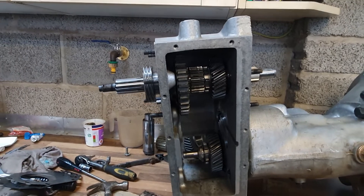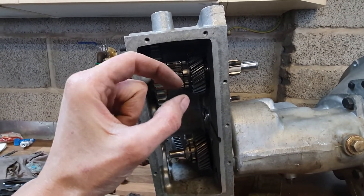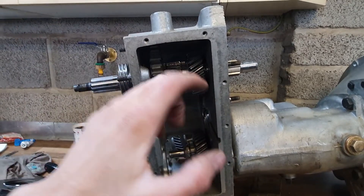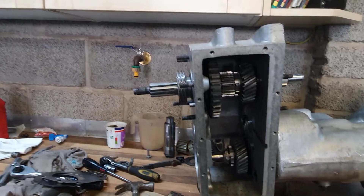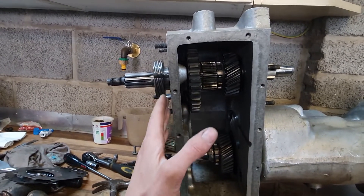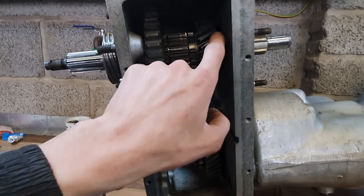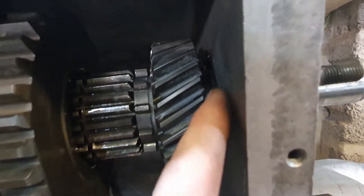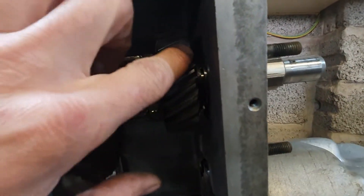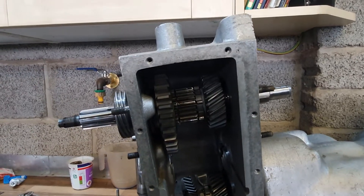I think I've found out now what's going on. The circlip has two tabs that you grip with the tool and those two tabs obviously stick out quite a long way from the shaft. So when the preload is put on it, it's bending those two tabs down. I need to put an extra shim in here and slightly reduce the preload on those bearings, and I'm going to grind a little relief where those two tabs are on the thrust washer so that they can't push so hard against it.